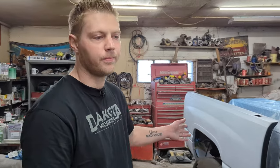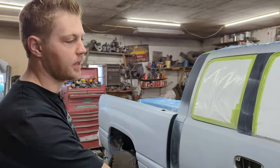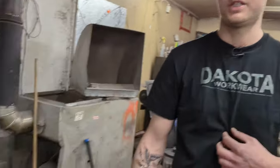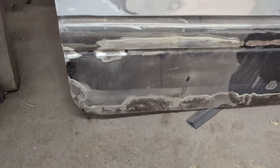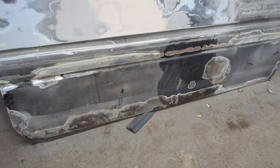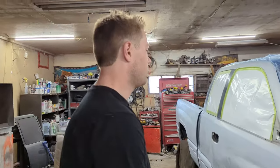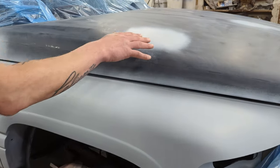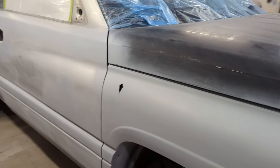So if you're doing this at home, you start with your metal repair — we ended up having to put new doors on this side because there was just no saving the old one. It was bad. So this is a cheaper single stage paint job. We did all the bodywork, covered it all in sealer primer, and the whole truck has been blocked out with 400 grit.